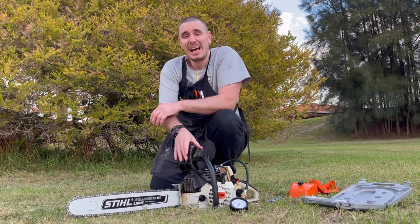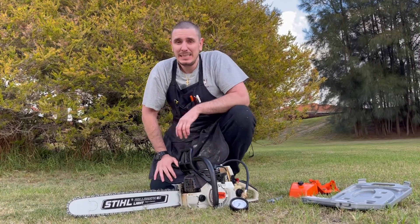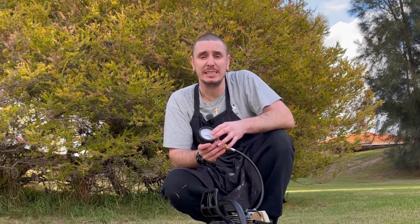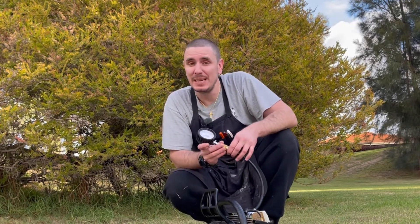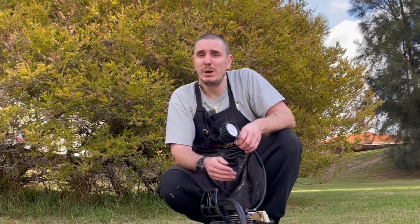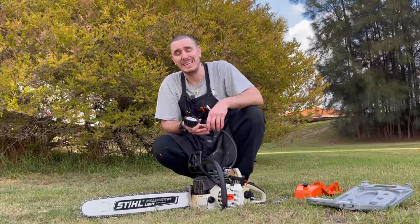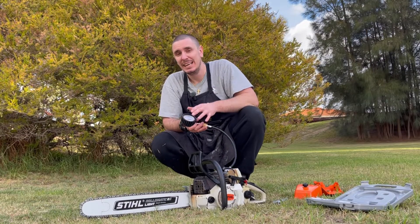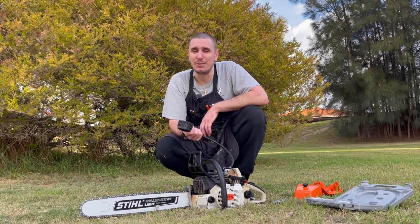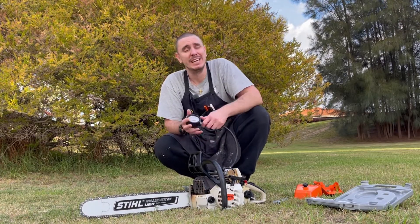That's a fantastic reading for this engine. This is an old engine but I have revamped it with new rings and gone over the whole thing, so that is somewhat expected but also really good to see. Don't get too hung up with how quickly the needle rises — it might take 10, 15, even 20 pulls to get that needle to stop. That's not necessarily a reflection on whether you've got good compression or not; it could just be that you're using a much longer tube. Don't think it needs to hold the reading for a set period of time — it doesn't, it's not a pressure or vacuum test. If it slowly bleeds down, it's just your Schrader valve leaking — it's not a problem.